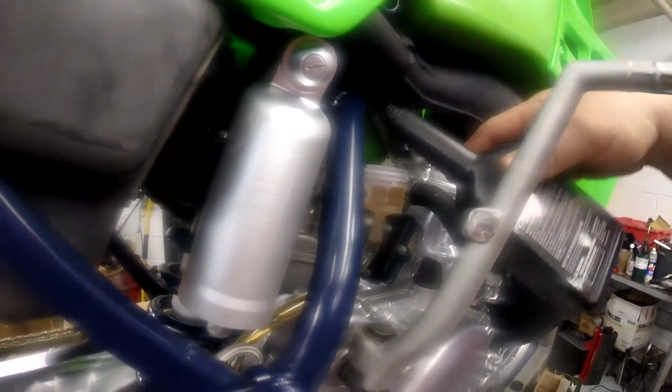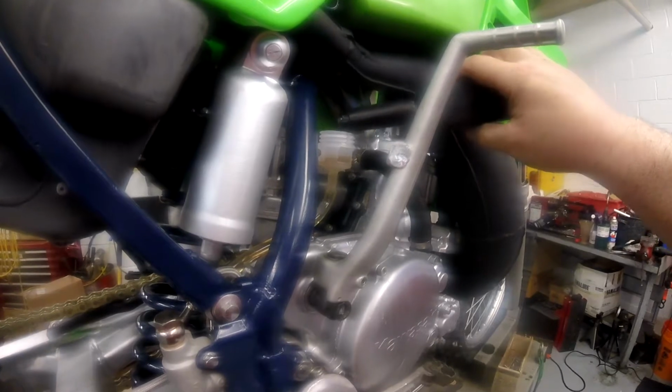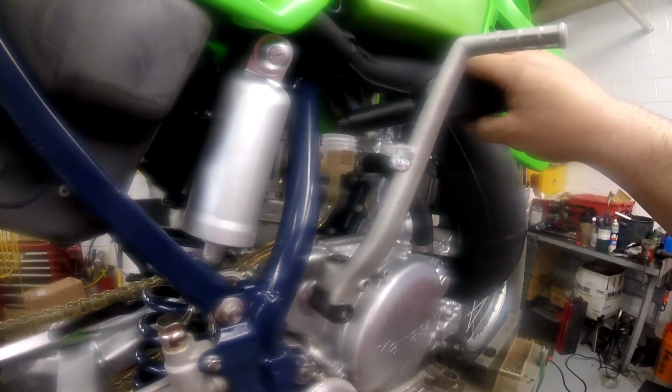Go ahead and just open that up and put vacuum on it. And look at that. Look at it pulling now, guys. See how much faster that is? I don't know if you can hear me over the air noise, but this is how professionals bleed brakes. See that? I'm already firm. I already have a firm pedal that fast.